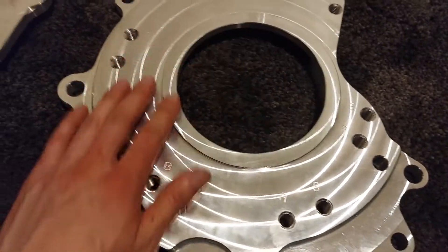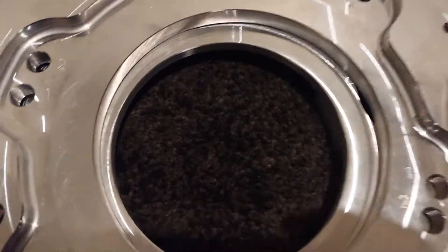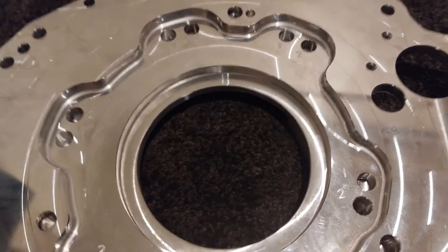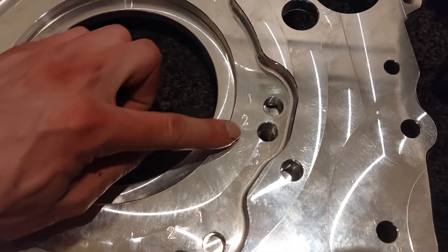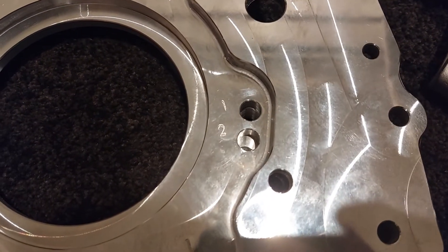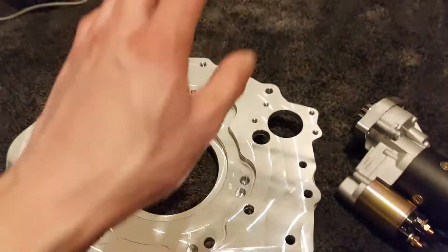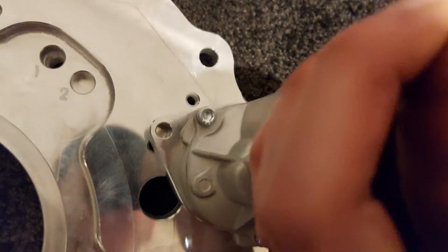Apparently it's clockable, which is nice. This is the Volkswagen bell housing pattern and this is the Toyota bell housing pattern. So this should just sit on here. There's a groove on the Volkswagen side, so it's kind of hub-centric — sits in there perfectly. The two plates will always stay centered. These holes are numbered and are clockable, so you can rotate your engine to the desired degree you want it to sit at. The starter will go on the other side, and it's clockable as well.